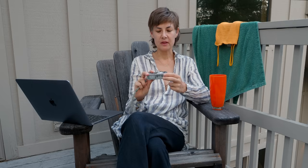Tackling some specs — we are dealing with a 2006 point-and-shoot camera. This camera has a 6.3 megapixel Super CCD HR sensor. It's an octagonal array of photodiodes that increases image resolution in the horizontal and vertical planes where the maximum detail in pictures should be found.